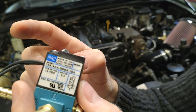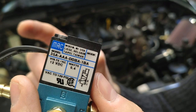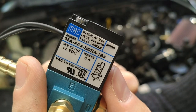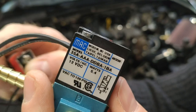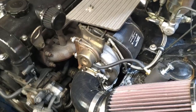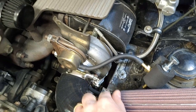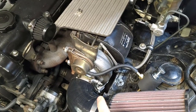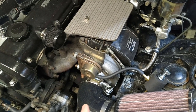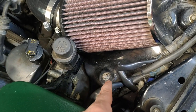In the car, this is happening very fast on a duty cycle frequency. If you say 50%, then 50% of the time power is being applied, the valve is closing, and it's only letting 50% of the air out. So that's causing the wastegate to only open a certain amount. Wiring this thing up is usually fairly simple. We don't want vacuum hose going all over the engine compartment, but at the same time we don't want it too close to the hottest part of the engine.